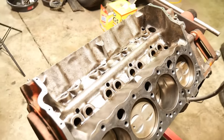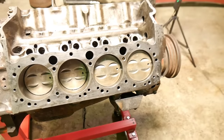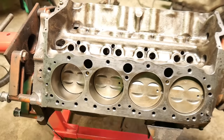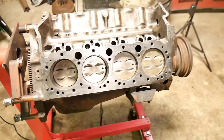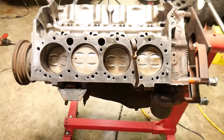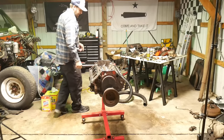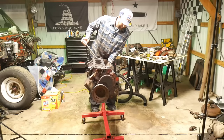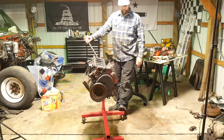Here's what it's looking like now — drastic change. Lots of elbow grease, but I'll get there. I even took my fancy piston scriber — which for me is just a roofing nail — and marked on my pistons which is which, because these definitely aren't going to be bored to round, so I want to keep each piston in the correct cylinder for reassembly. This is going to work just fine, so I'm going to flip her over, pop the pistons out, and start ringing this puppy.